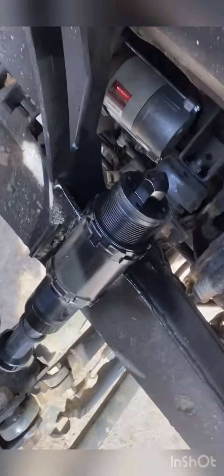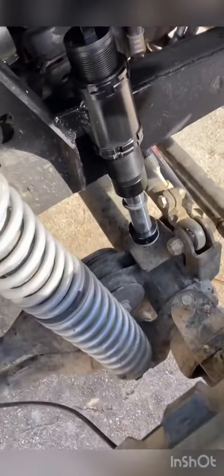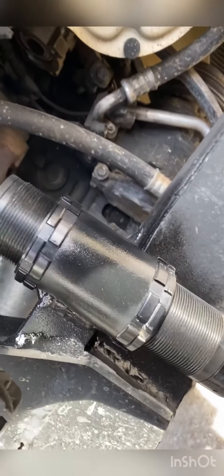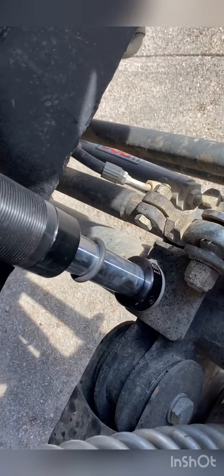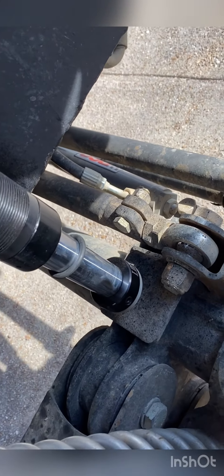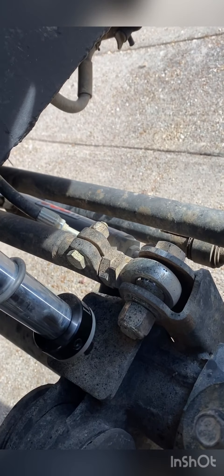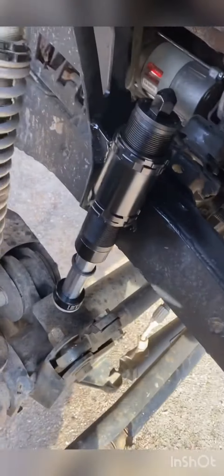It's the next day — paint set, bump stops are in. These are the 4-inch travel, so they ended up pretty much flush with the frame as you can see. I have them in the middle of the adjustment range right now. They're kind of loud hitting and contacting on the factory super duty pad, but the advantage to this whole setup is I was actually able to utilize the factory link mounts and the bump stop. It was a pretty fair install — and just so you have an idea of what it looks like, there it is.